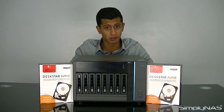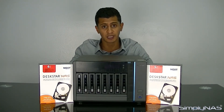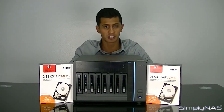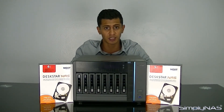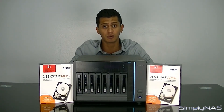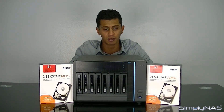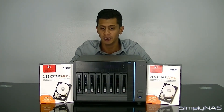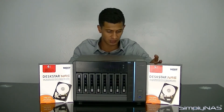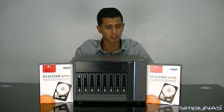Remember, you can get expansion units, so you're not missing out by not going to 8TB drives — you can always add an expansion unit, which is cost efficient and not the same price as buying a fully loaded NAS. NASs are effectively very cost-effective for what they do nowadays — they're no longer just boxes you back data up to. You can run your VMs off here, and you can connect this to a server via iSCSI and use it as an IP SAN as well, so there's a plethora of different things you can do with the NAS.